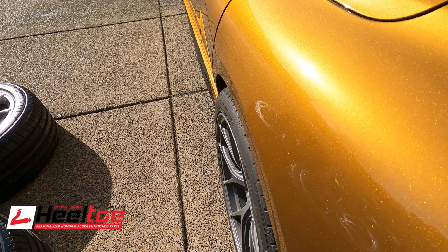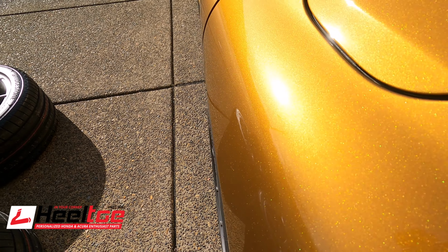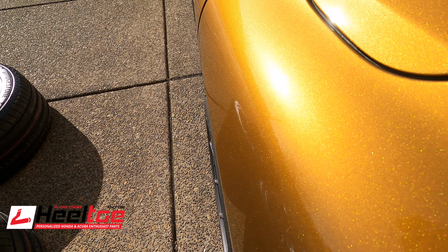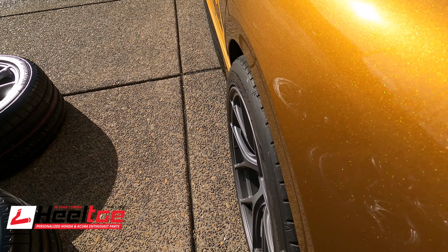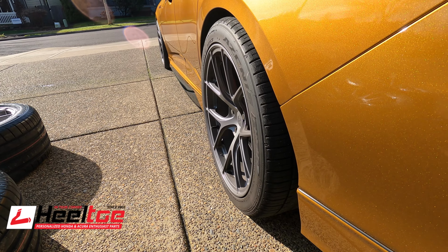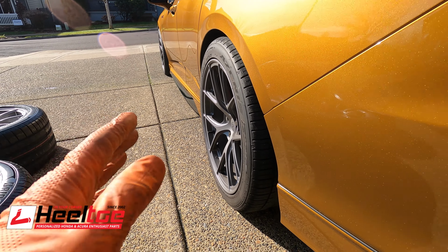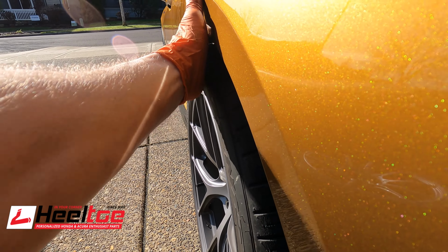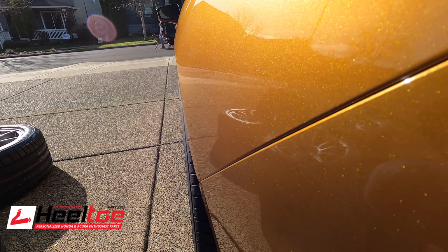The front does have a little bit more forgiveness than the rear does, but even still, you can see that as you come over the top of the fender, the tire is inside the fender. How square the tire sidewall is going to play a factor here, but you can see that even though it's bumping right out here, it's a very flush fitment.